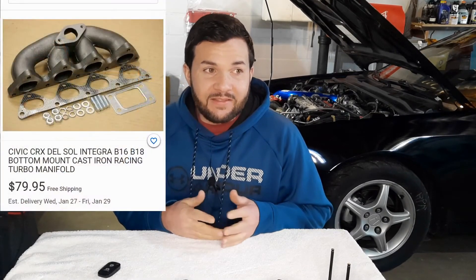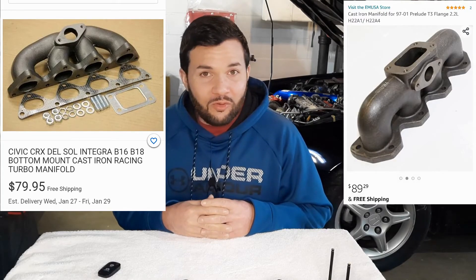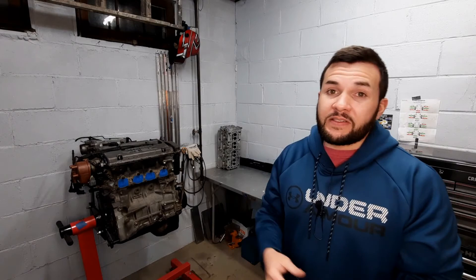I'd also buy a new spring for the oil pump and shim on top of that. Keep the stock cams — they're just fine. Leave the balance shafts just fine too. You'll need injectors — get a set of 1000cc injectors. Get yourself a cast manifold for about $100, and go out and get a proven eBay turbo. No problem.